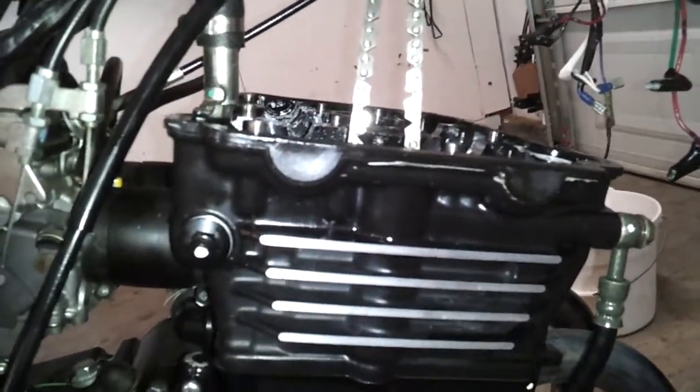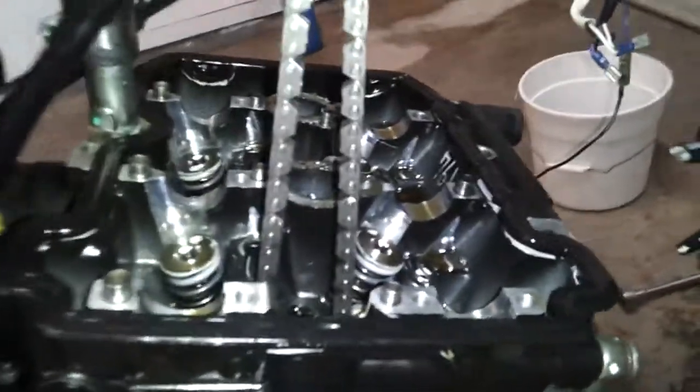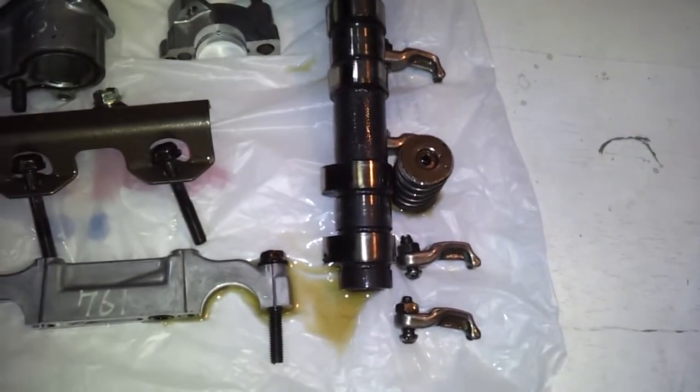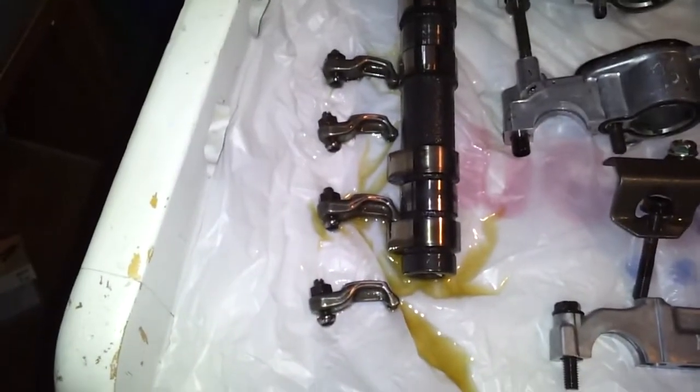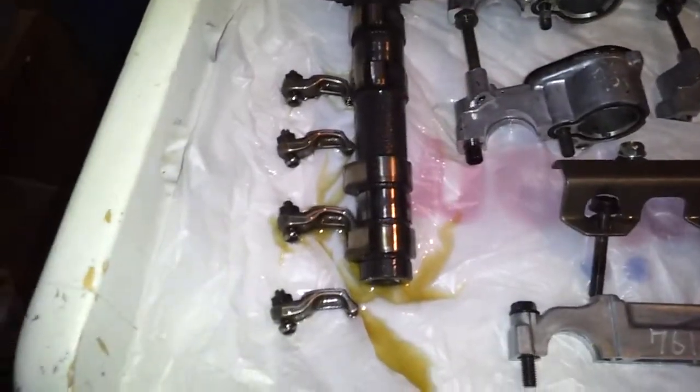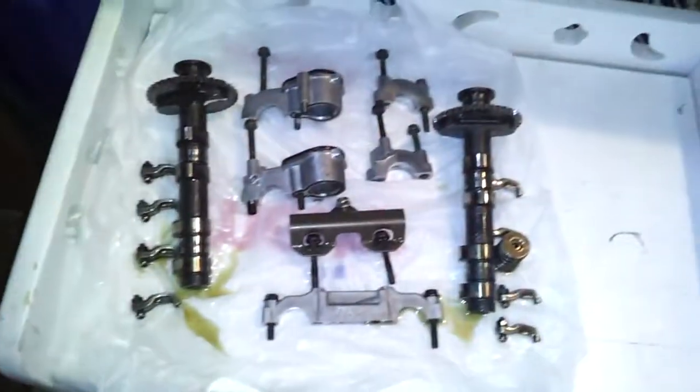Maybe I won't even need the extra hands in our situation, because all I need to do is tap out the old valve down in here, slide the new one up in, and set this right back down — assuming I don't find any more damage. I'll recommend keeping your rocker arms organized: keep your intake side and your exhaust side together so that when you put this back in you have to do minimal adjustments. Keep all your intakes and exhaust together so your clearances should be near what they were before, assuming they were correct.